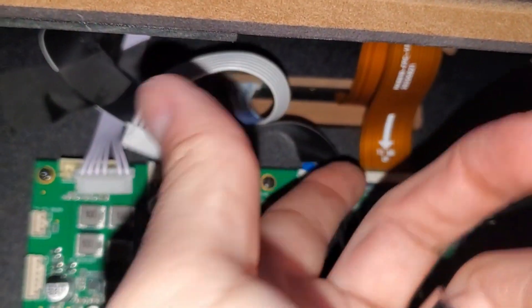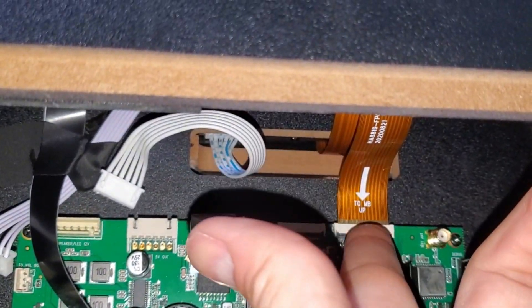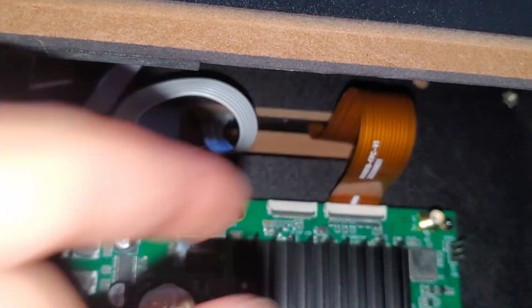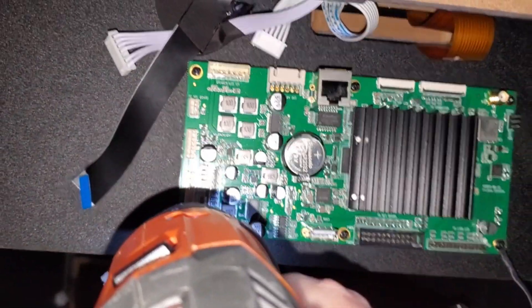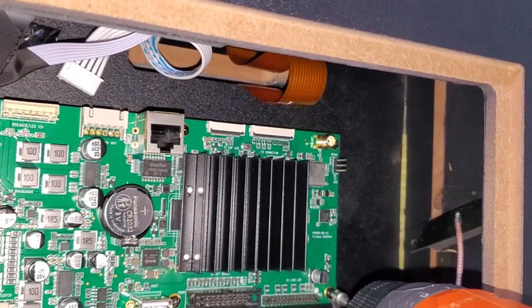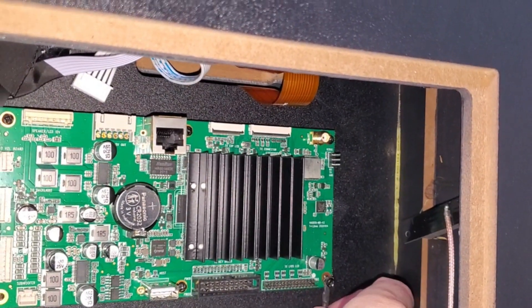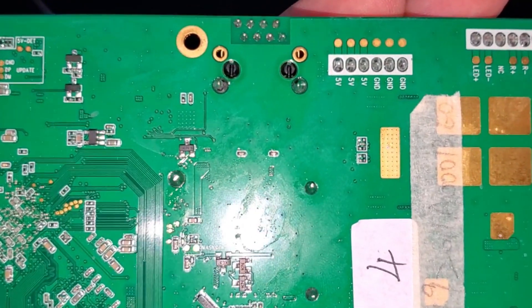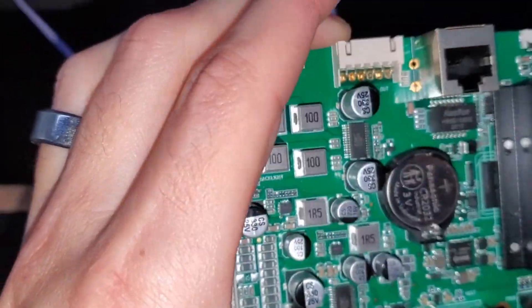You lift that up and flick it upwards and that comes out. This one is the same — just get your fingernail under that and flick it up, and that pulls right out. Once you remove all the plugs, you want to just unscrew it and unscrew it from the cabinet. That's the ground — that one's important. And this is my board number right here — that's version two. If you want to test it, there's your ground and five volts right there.